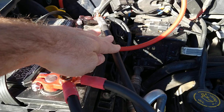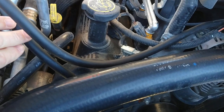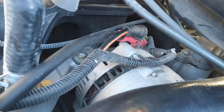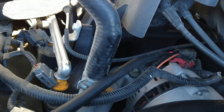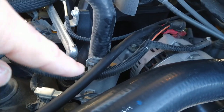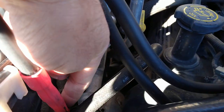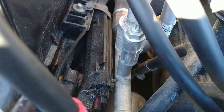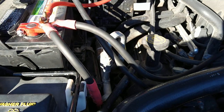Here's the positive — it runs directly to the alternator lug, and I did leave the existing alternator charging line on there as well. From there it goes right up to the starter solenoid lug, and from there it connects to the factory wiring. I left that because it does have fusible links right there, so I wanted to leave that in place. Basically I left all the factory charging stuff in place and just added over it.